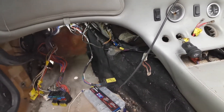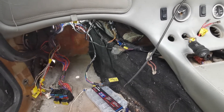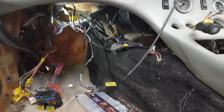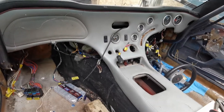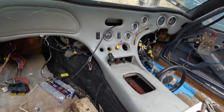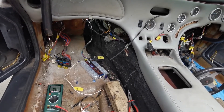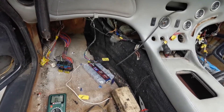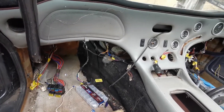I just had a nightmare trying to get the heater going. It was all plugged in, it was getting 12 volts but just wasn't working. So I tried getting the battery in to get that to go — it was a pain so I had to take it all out just to test it. I wired it straight to the battery and it worked. But it was getting 12 volts through the actual wiring loom, and what I did is I just swapped out the fuse — changed it from a 15 to a 20 amp and now it works.